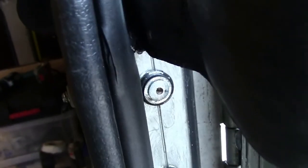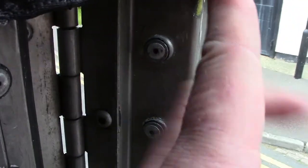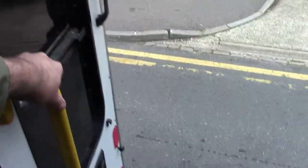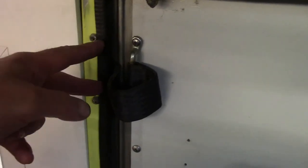Every main door on this ambulance has got two little stainless steel contacts on the pillar and two on the door. When they're shut, there's a little rubber ring behind them that gives just enough spring so they can contact and stay in contact with each other. When I test those contacts with a multimeter I don't get any voltage, but I think lock is live at the bottom, earth at the top; unlock inverts that. It locks all four doors, so I know the central locking works - it just doesn't work off the van.